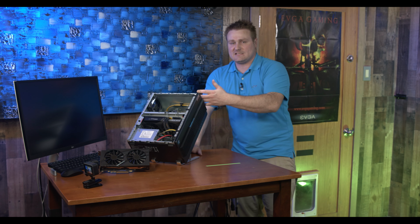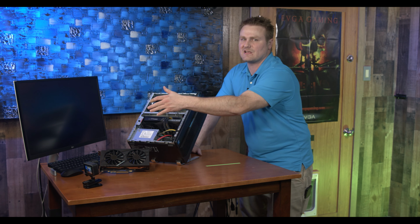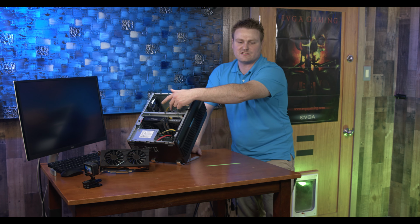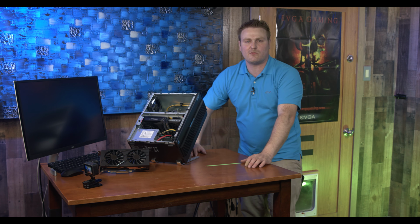You know what, guys? I was really surprised after running all the gaming and benchmarks with this guy of how well the RTX 3070 did. So I've seen about 55% more FPS. There's more shader units. You're looking at about 2,304 more shader units. The bus, so on the RTX 3070, you have a 256-bit bus versus the 192. Yep. 28 RT cores on the 3060 versus 46 on the 3070. It's just about double the performance as you cut it across the board.